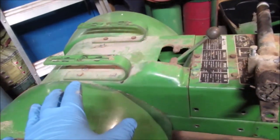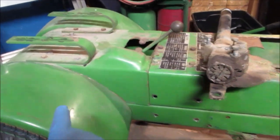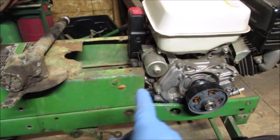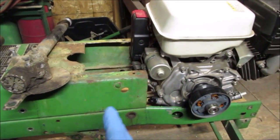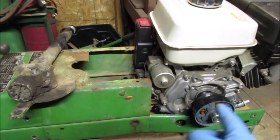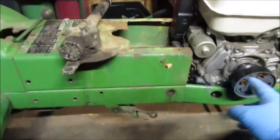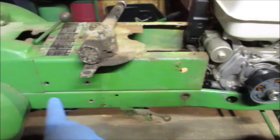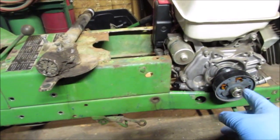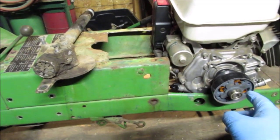The brakes on one side, the pulleys over here. To put a belt from there, approximately here to here, is going to be a big long belt. Like I said, we don't want to have to use a jack shaft. We'll be having to have help finding out gear ratios as we do that. Where I go to the farm store, a lot of farm equipment, they had a lot of belts. You see that's like 3 foot distance? Well, that's 72 inches, plus you gotta go around some pulleys. Let's say it ended up being like an 80-inch belt. I think I can get a belt that long.